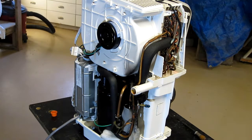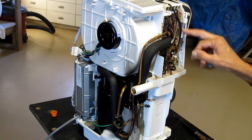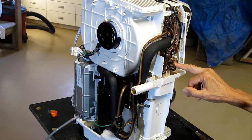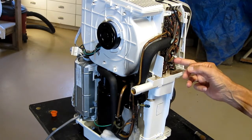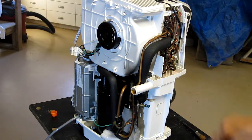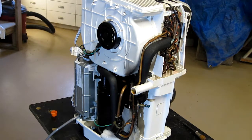To begin with, to verify that it really is a refrigerant leak, I ran the unit until the compressor kicked on. First I put my hand on the compressor to figure out if it's really running, and then I can touch the evaporator coils — they should be cool. They were warm all the way down to where the refrigerant enters. The capillary tube was warm, but it was cold where the beginning of the capillary tube is. So it must have had just drops of refrigerant left in it. I can proceed with my little experiment.